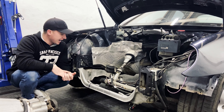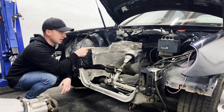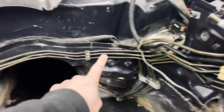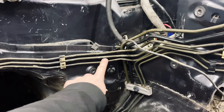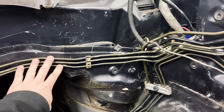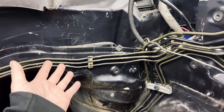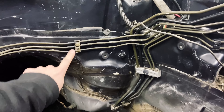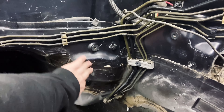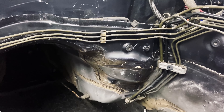I need to get started by cutting this. Now this is a pretty important support piece because your control arms kind of connect to it and it gets everything nice and together. But the way the engine is, the oil pump sits directly over this. I've had many sleepless nights over this, but there's no way around it — we have to cut a piece out. I did get some aluminum tubing to reinforce it as best as I can. As you saw in the previous video, I already got the oil pan done so that's ready to go.